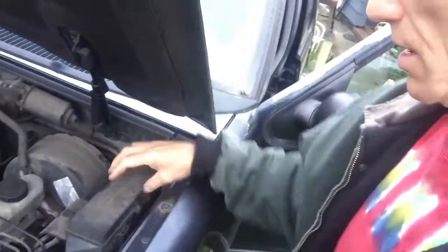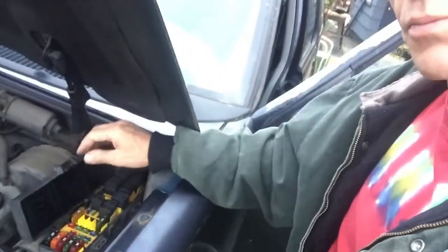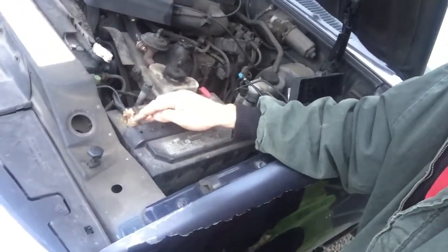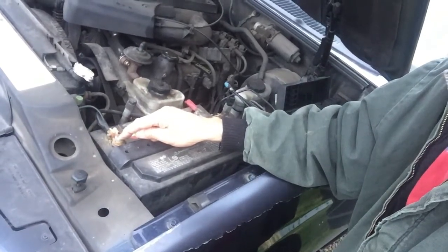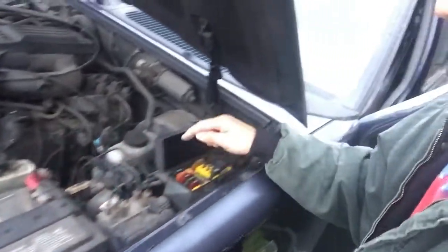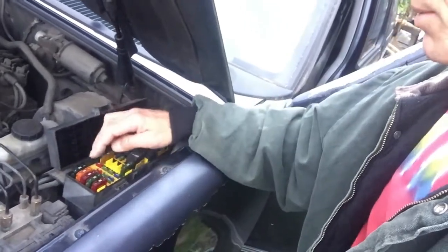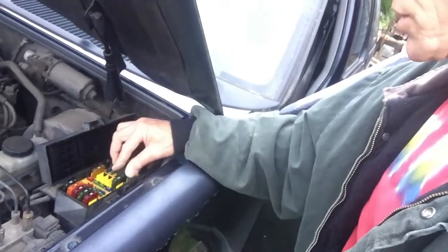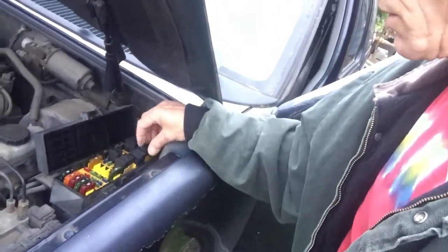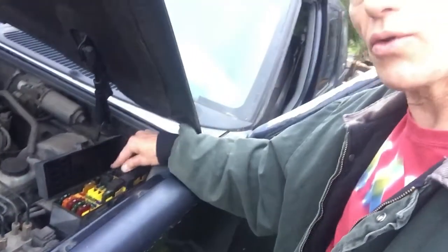So you check the fuses. Here's your fuse box. Here's your ground wire to your battery. You put your tester to the ground — negative, black — and you take your other tester and you check your fuses, each one. Basically test all of these fuses. You can also adjust and wiggle these relays a little bit. Make sure the contacts are good on those.